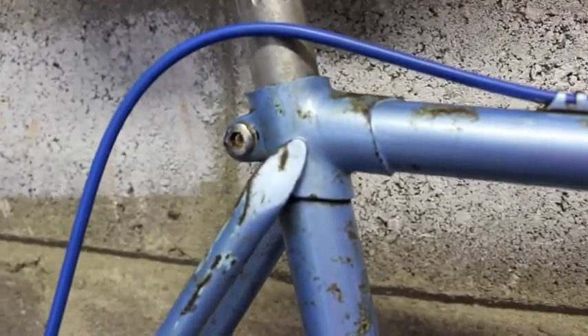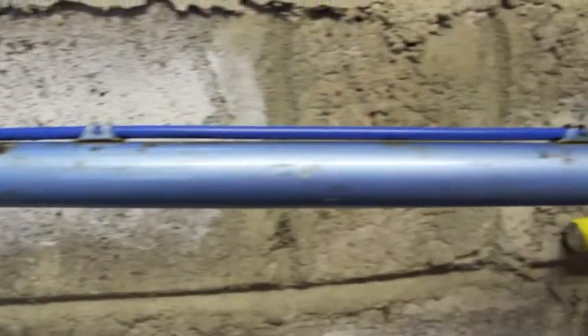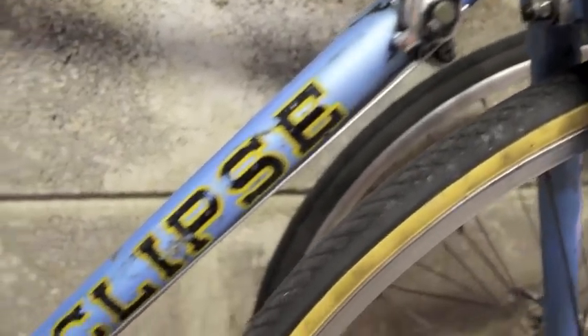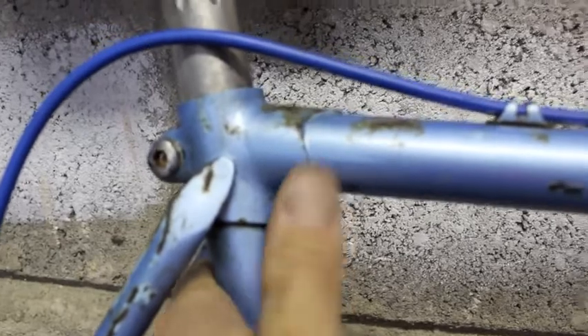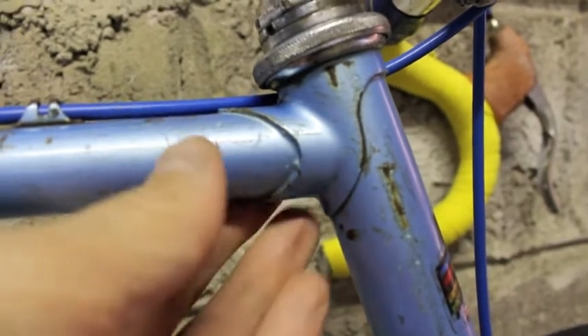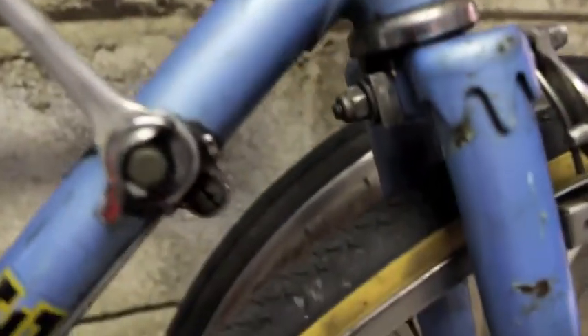I'm going to show you some things to look out for when buying an old bicycle. This Thunoda Eclipse is easily over 30 years old and there are some rust spots on the frame — nothing too serious, but I'm not going to respray it because I'll never match that colour and I'd lose the decals. Make sure that the lugs — that's where the tubes join each section — have no cracks. If you see a really nice bike and it's got cracks, walk away because that's the frame gone.